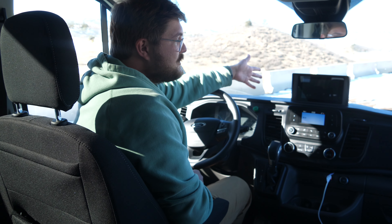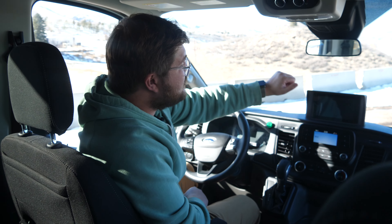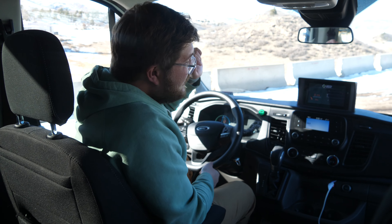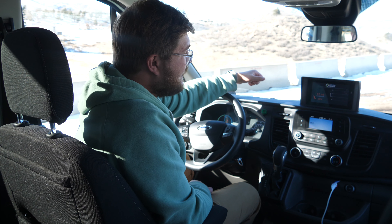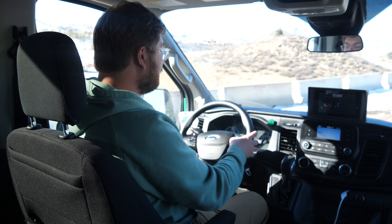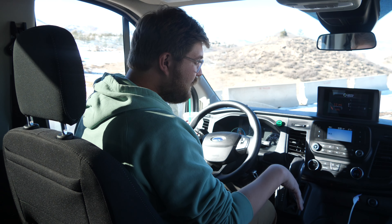The display shows your efficiency in miles per kWh — I've been averaging around 1.5 to 1.7 miles per kWh during testing. You also have projected range and state of charge: right now we're at 9% state of charge with a 12-mile estimated range, which is about average for 125 miles on a full charge. When you start it up you get hill start assist not available and cruise control doesn't work, but other than those two niggles, everything else is totally factory.